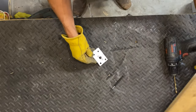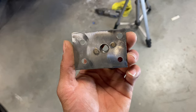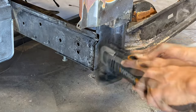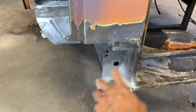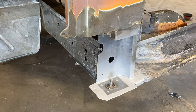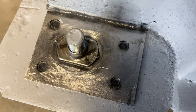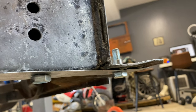It is typically spot welded on from the bottom — it's actually a part of the D-pillar spot welded on from the bottom — but I'll be spot welding it from the top because I don't like getting hot slag in the face. After thoroughly removing the rust from the inner D-pillar, I sanded it down and cleaned it up to prepare for the zinc weld-through primer. Do not forget to use this stuff between any metal that you're going to be welding together — it's going to keep it from rusting, or at least prevent it for a lot longer. I like to remove the primer right where my electrode is going to touch, as you can see right here.